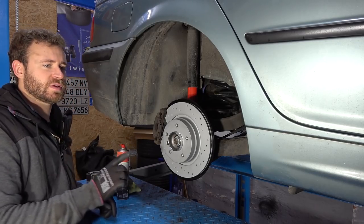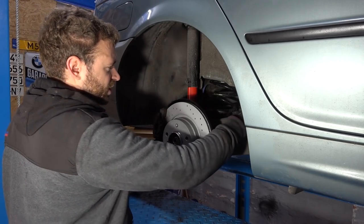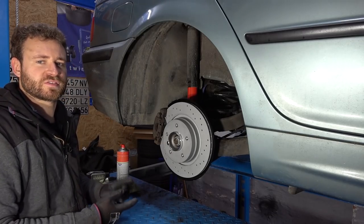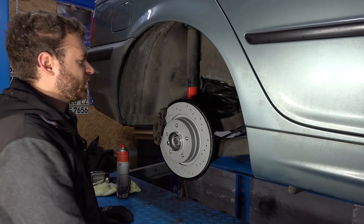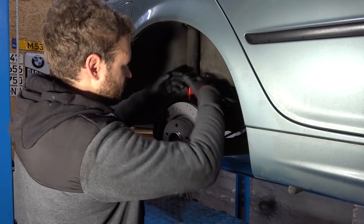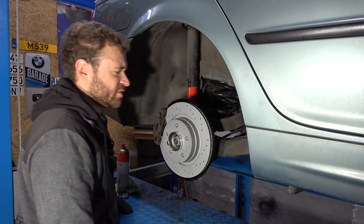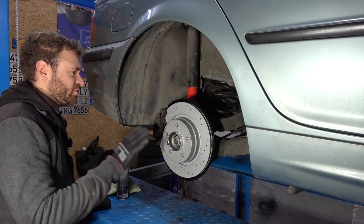And while I do that, I'm also gonna get stainless steel brake lines, replace this hard line because it's rusty, and do 330i brakes on the front. Discs, caliper, pads, and whatever else comes with it. I actually want to do 330i brakes on the back as well, but then you have to replace the complete trailing arm and all the good stuff because something with the parking brake is different. Not sure what exactly, but that's what the internet says, so I'm not gonna mess with it for now.